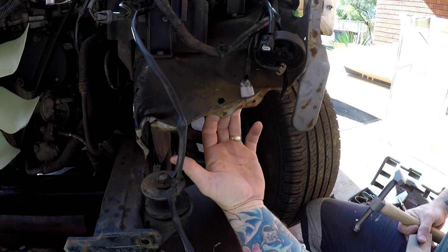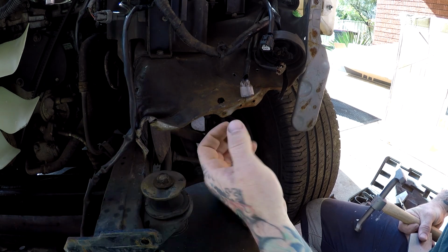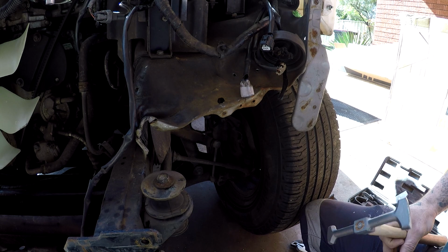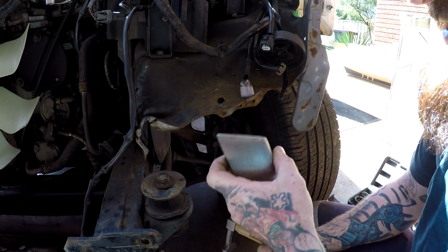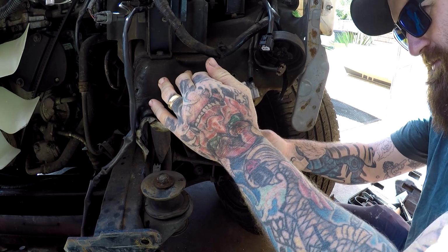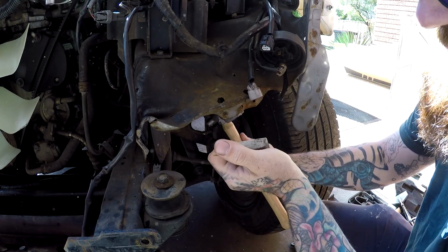It's not always going to be just hammer and dolly on this as well. That one there is fairly bent back. I'm going to have to shove a pair of pliers or some multigrips or something on that and start to pull that back through. Everything's a hammer, unless it's a screwdriver, and then it's a chisel. So the noise you want to hear more likely, you want to put that on your high spot and smack down on your lows. You want to push that out, not stretch it.